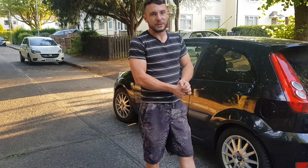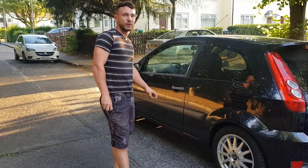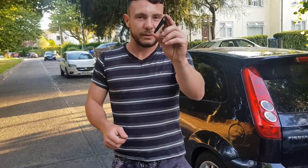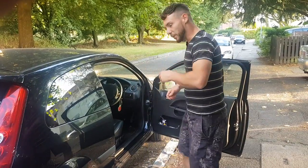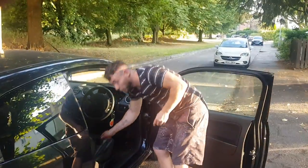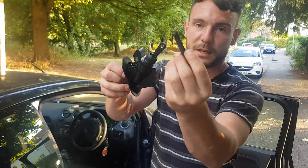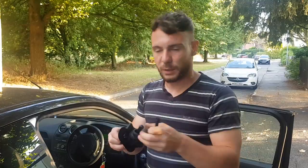What's up guys, we've got another DIY tutorial today. We're going to look at this Ford Fiesta 2007 model and it's a broken clutch master cylinder. This part here connects directly to the back of your clutch pedal. You can see it's just made of plastic — this has snapped. We're going to take the old master cylinder out and replace it with a new one. This is the new one and as you can see it's got this plastic bit which on the old one snaps off again — just through wear and tear, it's done a few miles, this car.